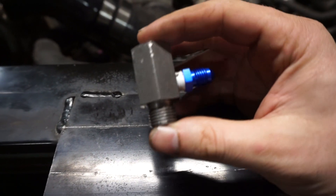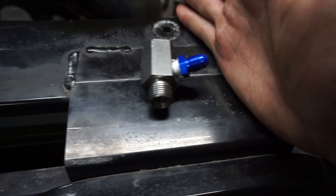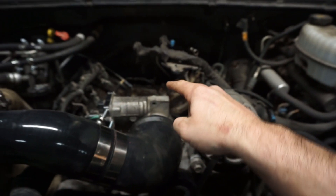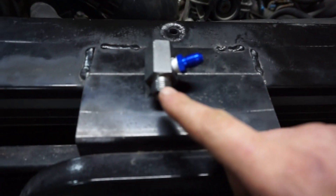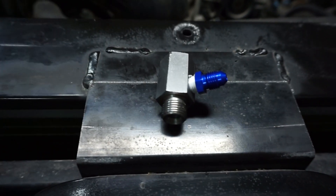There's what the fitting looks like when it's all done — just drilled and tapped, and I got the 1/8-inch NPT to 4AN fitting in there. I am going to have to take this out because the cam sensor and the bolt for the valley cover is going to be in the way. So I'll thread this thing all the way in and then put that on from the backside once it's fully seated.